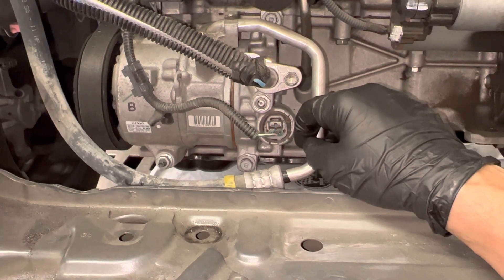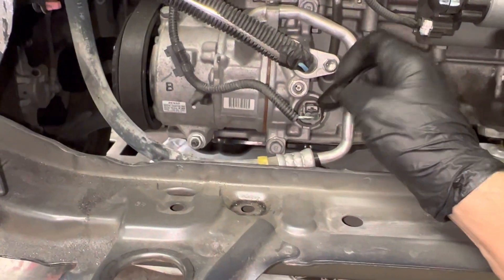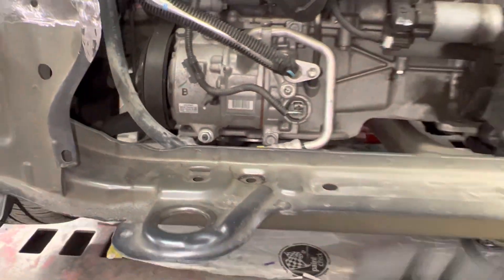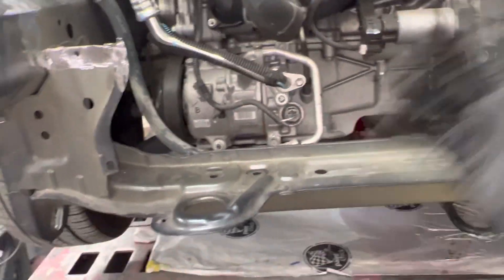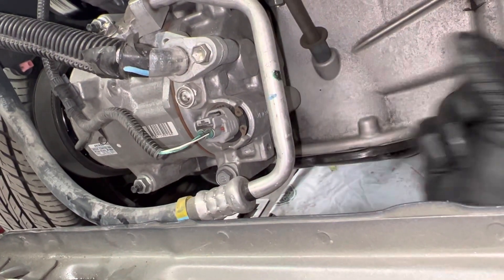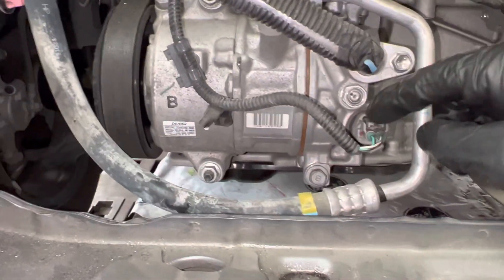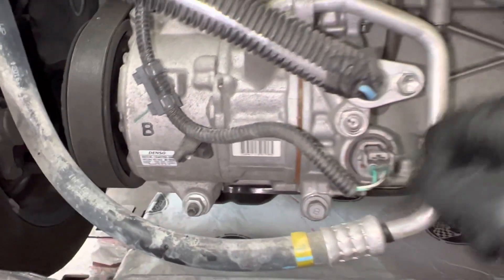There's a Ford — newer hybrid vehicle, the Ford Escape — that still has a mechanical valve in it that you can take out and change. It's still old-fashioned mechanical, not electronic, very easy to change. On the Ford you go from underneath, it sticks out this way, you take out the c-clip, pull it out, put in a new one, and you're good to go.